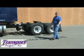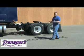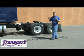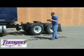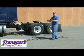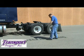Alright, so you've got your chains laid out. Now it's time to hang the iron. You're going to have to roll onto the iron, so it's important that we hang all the iron on the truck in the exact same manner. So in other words, you have the same positioning, so when you roll the entire rig forward, you're looking at the same situation on each wheel as far as where the chains are. Okay? So I'm just going to pick this up.